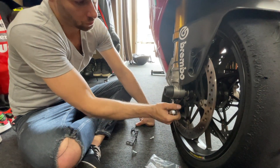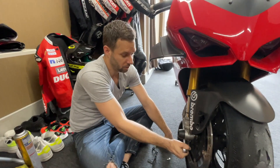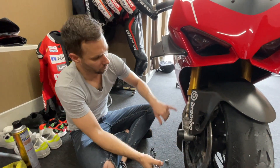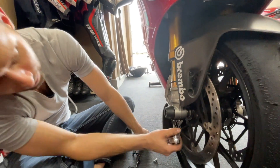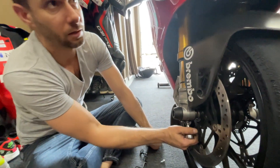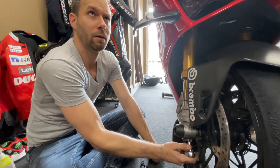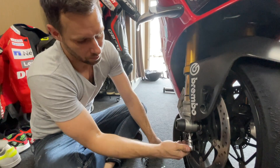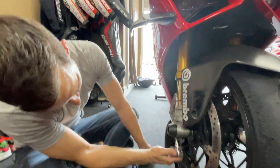For all you viewers watching, make sure you put a ton of grease on these types of bolts. Every bolt — like the brake bolts — needs grease. The reason is especially if they're titanium, titanium tends to gall. So they tend to seize up. Are you tightening it? I thought you were going to put this piece on first.